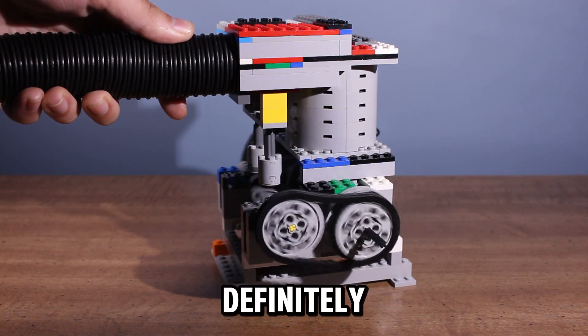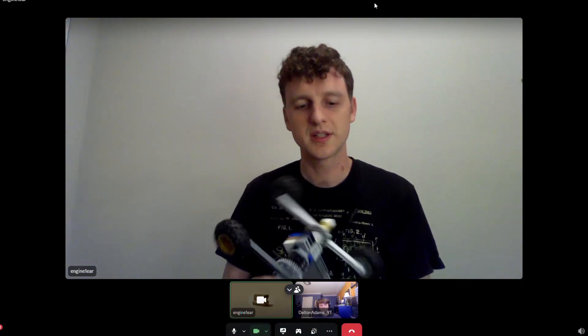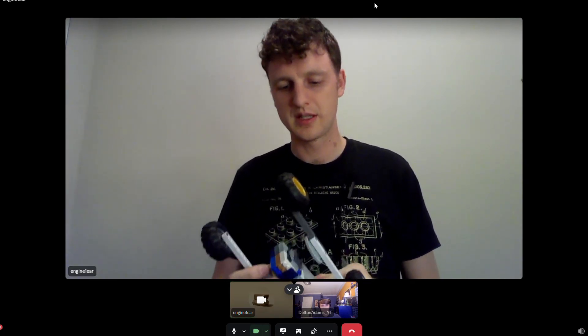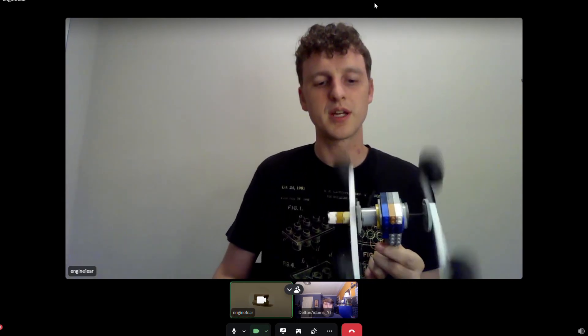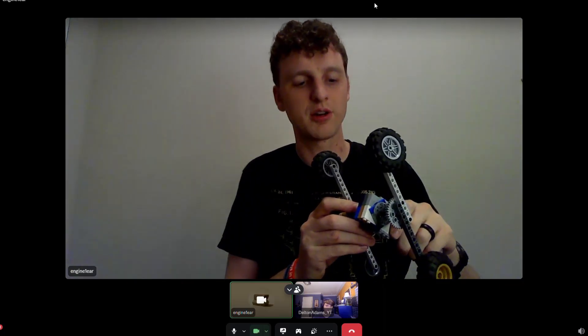This one was definitely surprising. I figured it would run better than the normal one, but that's apparently not the case. I'm not exactly sure why this is, but my friend engineer has a theory. So I think the reason why this needle bearing doesn't work as you might expect it to is because there's a lot of play — and you can hear it in mine. It runs okay as long as gravity is pulling it downwards, but as soon as you introduce the vacuum sucking the crankshaft upwards, you really get all of the play of that shaft.